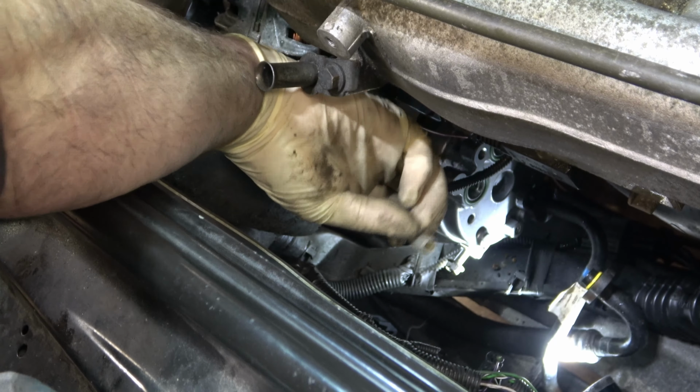We have our system sucked down into a vacuum. We have our compressor and our fan and everything else in place. All we'll have left to do after we refill this thing is to put our power steering bottle, reservoir, and our coolant expansion tank back into place, which won't take but a second. What I've done is gone online, and it takes 2.19 pounds. I'll put in 2.2. That accounts for some loss in the lines because not all of it will enter the system, and I'm going to do that right now. Let's see if it works.